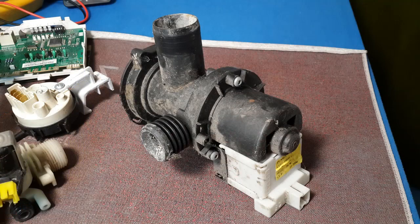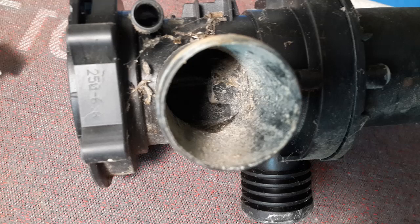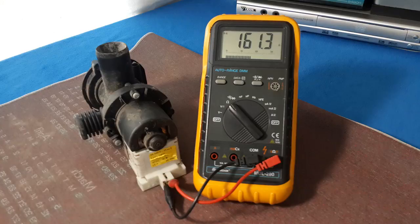This is the water pump. The water pump doesn't have too many problems. Sometimes we have to clean it once in a while because it will get full of fibers, and this is something related to the normal maintenance we have to do on the washing machine. To test it is very easy. With the ohmmeter, if we don't have access to make voltage or current measurements, we can still check it. Its resistance should be just a few hundred ohms.